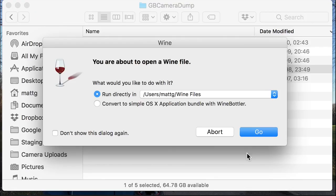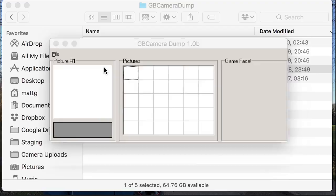Plug it into Mega Memory. Back it up. Replace with USB Flash Card. Restore the backup to that. Plug the USB Flash Card into the computer. Use EMS Flasher to get the data off. Run GB Camera Dump in Wine. And you end up with a load of lovely 128x112 pixel black-and-white pictures.